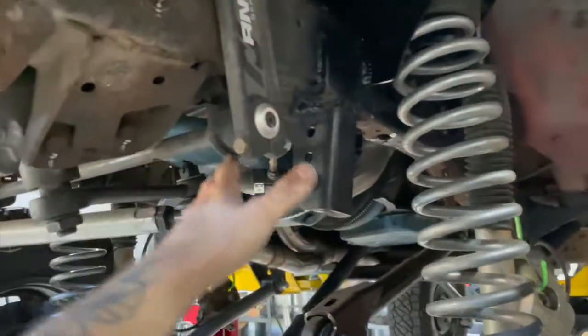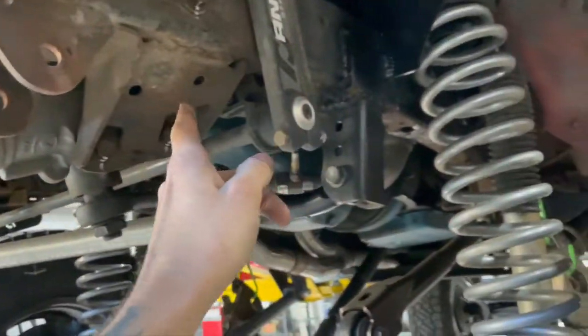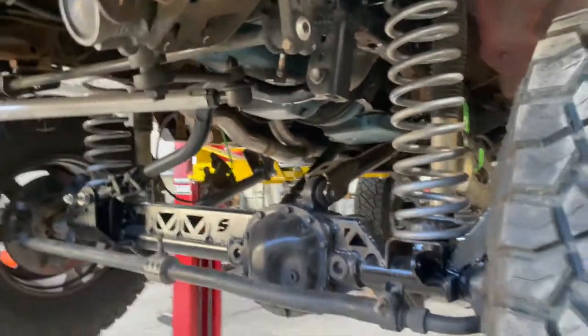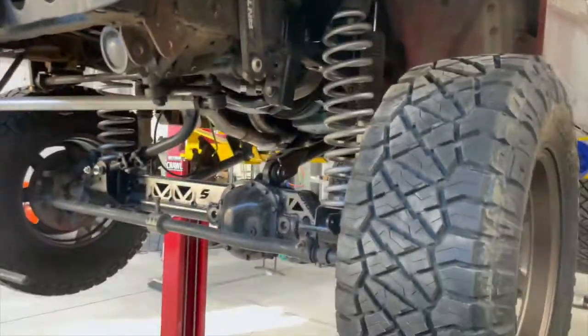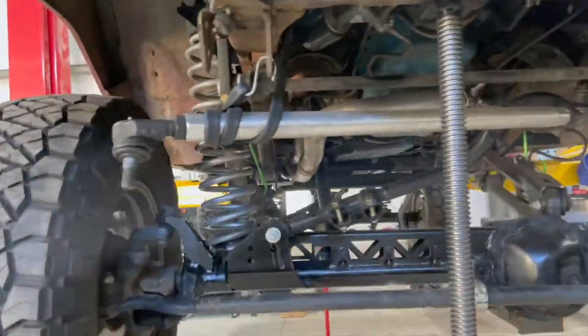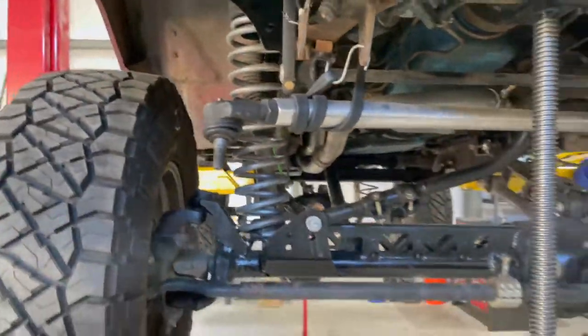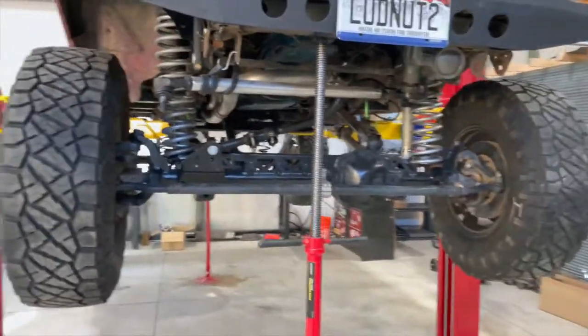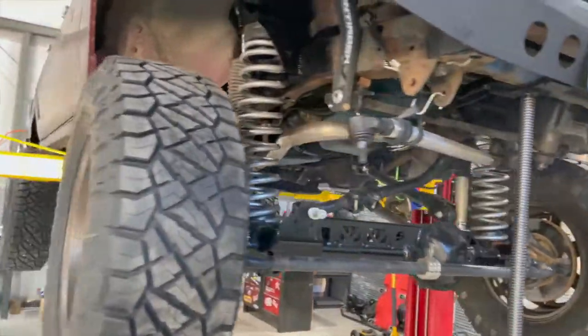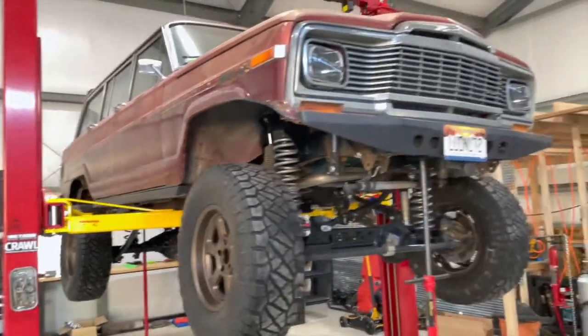I have the Rock Jock anti-rock — it's currently in the stock position using what I think is a JK kit adapted for this. But now I have a coil bucket right there instead of down below, so I'm actually going to be cutting those off and running it across right here. I'll need some longer ones to line up with the axle. For steering it's going to be an RPM one-ton kit — solid aluminum with one-ton tie rod ends. I don't need the two-and-a-half ton kit; like I said, it's just going to be a cruiser — go to the store, get groceries, come home.